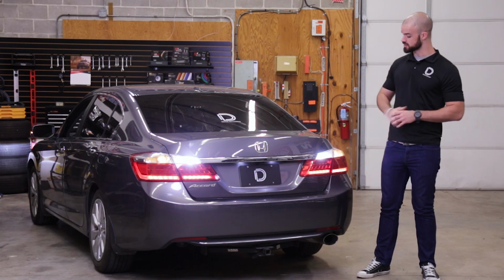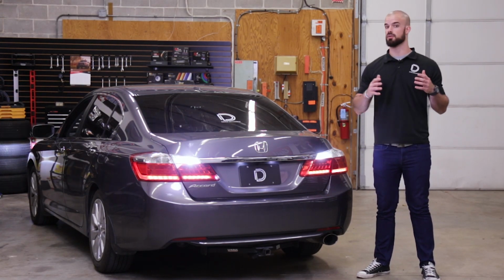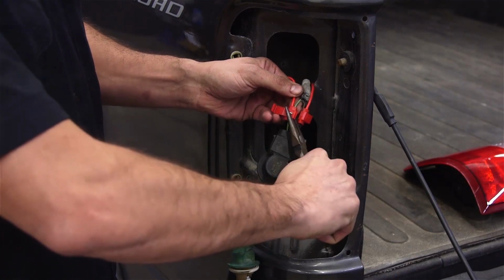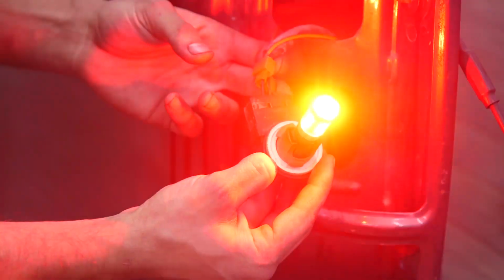Now on these LED rear turn signal bulbs, we do recommend installing our resistor kit in order to prevent hyperblinking. If you're not sure how to install resistors, don't worry, the link to our resistor installation video is in the description below.